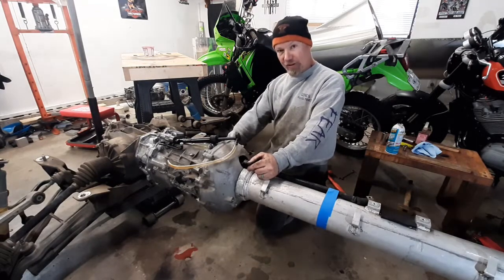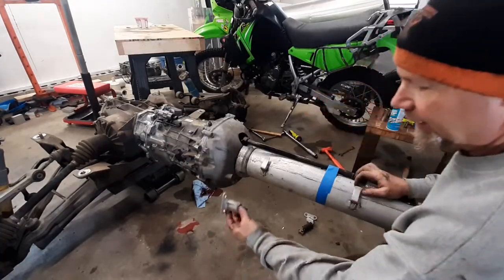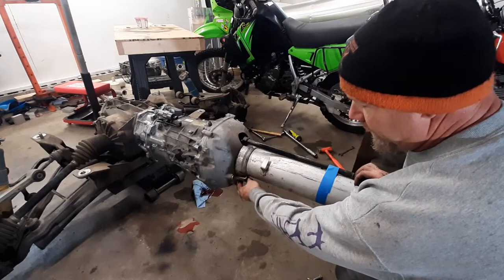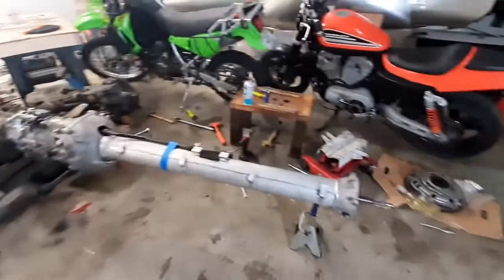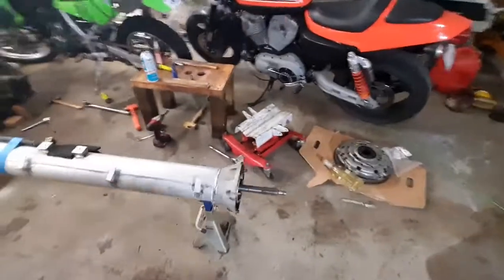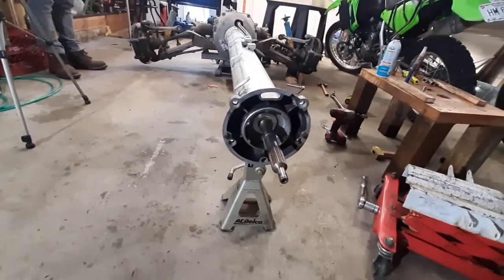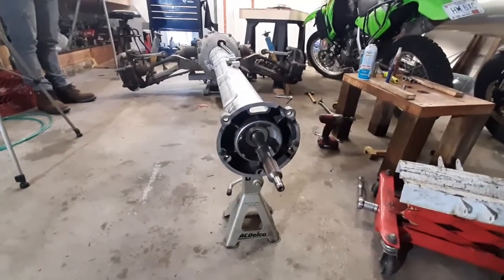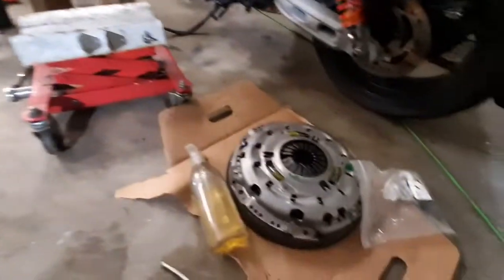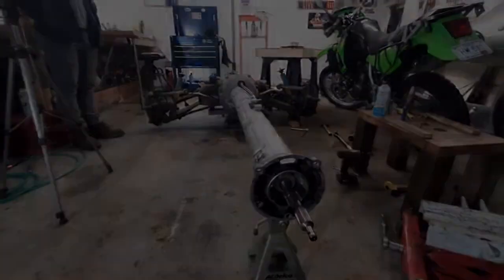Pump it in through the fill hole until it's level with the bottom hole, put your plug in, and you're done. One more thing you can put on now that won't be in the way and will save you from doing it under the car later: the two muffler hangers that go on this little bell housing — just bolt them on each side. The transmission is full of fluid and the exhaust hangers are on. The last thing I'm going to wait on is the slave cylinder on the front — I'll put that on last before we slip it together. Next up, I've got to crawl into the car and put the clutch in, but it's raining so I'm going to finish this video and see if the rain quits.